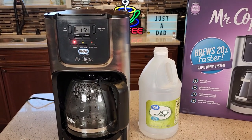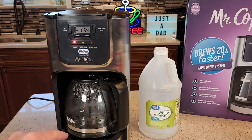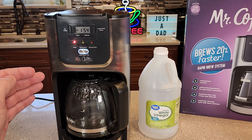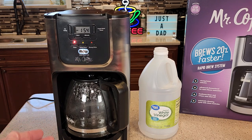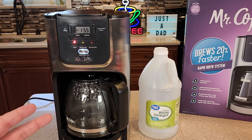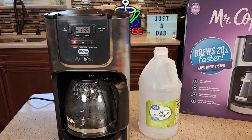You're going to have to give yourself about an hour to do this start to finish. The process is going to take a while because it brews a little bit of that vinegar and water and then stops, brews a little bit and then stops — it's an automatic cleaning process. So you can go do something and come back in a little while. You can see it's just barely brewing a little bit and it stops; you might think it's not doing anything at all, but that's good — it's pausing.